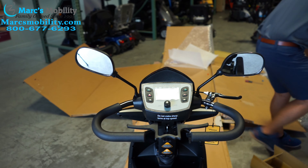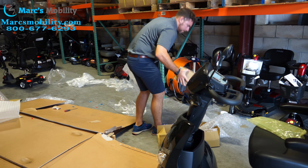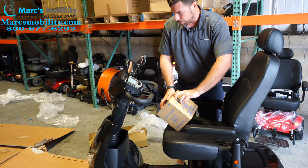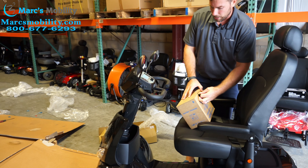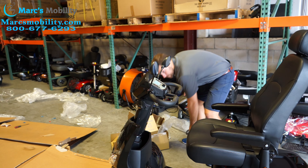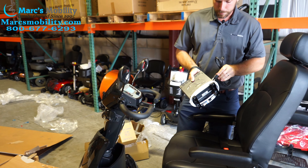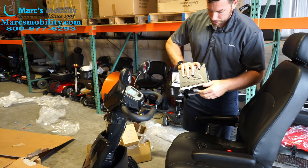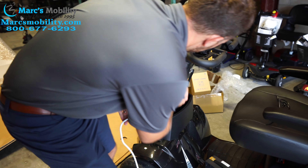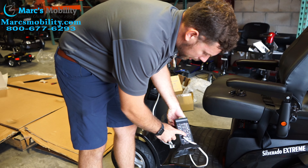Your mirrors are now mounted. Last in the bubble wrap is an 8-amp charger that comes with these units. The unit will come with some charge on the batteries — right now it's indicating full. It's typically best to charge it fully overnight after the first use. On a typical charge it's going to take about eight to ten hours if the batteries are fully drained. It's a three-prong computer cord on one end — if you ever lose it, you can buy a universal one online — it plugs in here, and the other end goes into any 110-volt outlet. On the scooter, push the little tab out of the way and plug the circle connector in there.